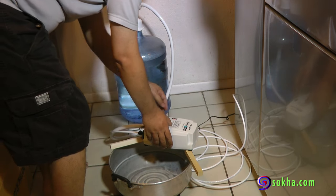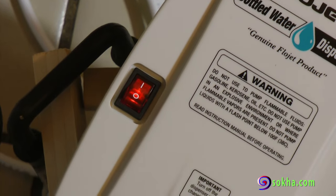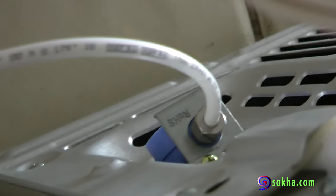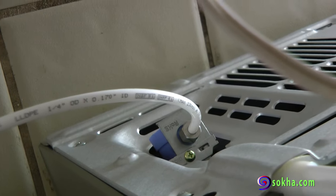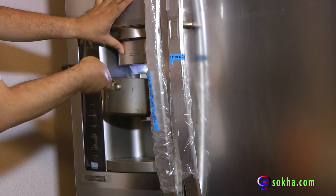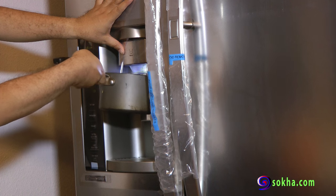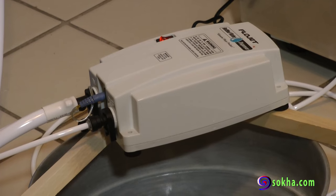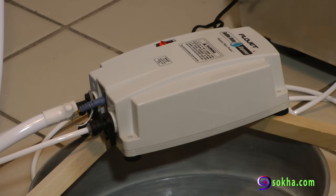For the first 15 gallons, turn on the pump and check all the water lines to make sure there's no leakage. I put a pot under the pump just to be sure — in case there's any leakage the floor doesn't get wet. Here's the back of the fridge: no leakage and the pump is on. The first 15 gallons just gets all the plastic smell out. Now pay attention to the pump's noise.